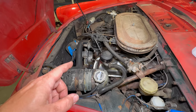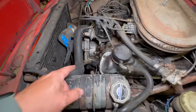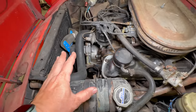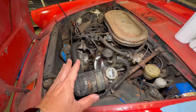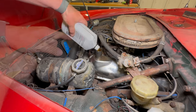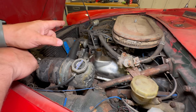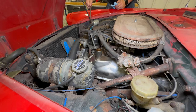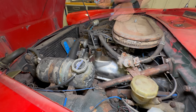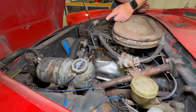Here's what it looks like under the bonnet of the Sunbeam Tiger. Up here, right where the circular bracket is, that's where the original oil filter would go. It's nice having this out of the way when you already have very little access to everything on the engine. I put four quarts of oil in — let's check the oil level now. The oil is up at the full mark, so let's start it up and then I'll top it off if needed.